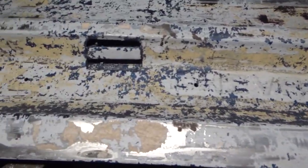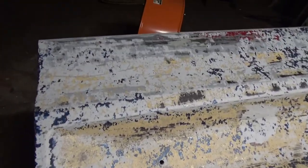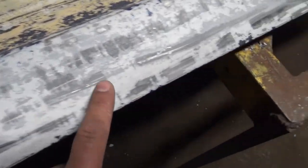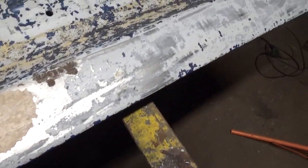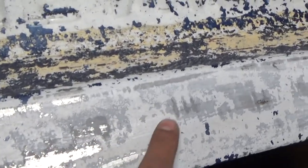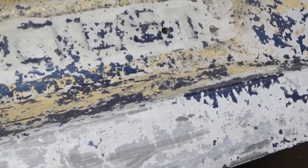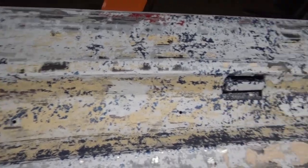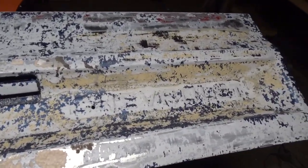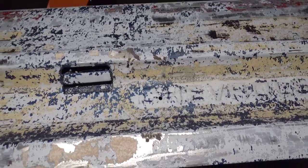This is where we're at after using almost the whole bottle — the bottle is empty, but I had already used a little bit out of it. You can see right there it's almost bare metal. Some places it is, but on this primer it didn't really make it curdle up — it just kind of liquefied it, so I just moved it around a little bit and it didn't really come off. But overall I'm satisfied with that. That's going to save me a lot of time. It took almost all of that blue off — it had a layer of clear coat and blue base coat on it, and it took almost all of that off.